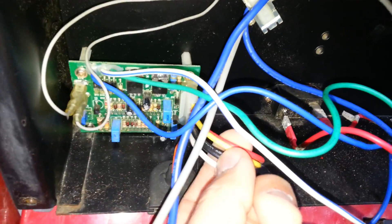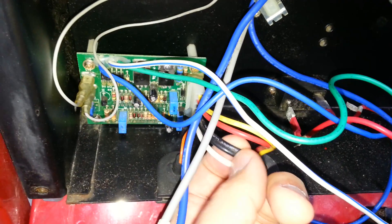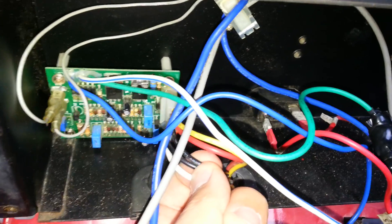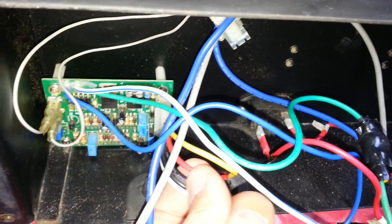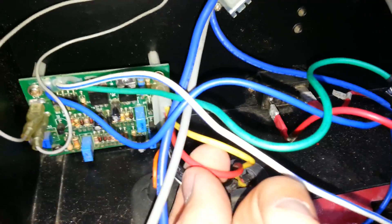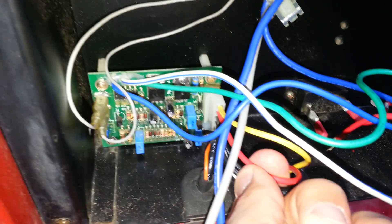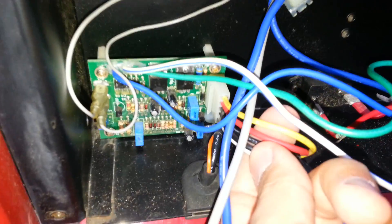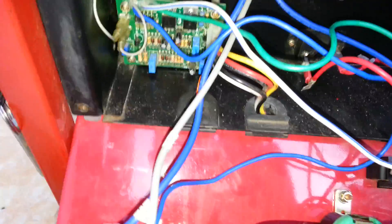The yellow wire is for the low oil sensor switch. The two black wires go to the idle solenoid itself. The red wire and white wires are for the other part of the wiring harness that operates the low oil pressure switch and other components, including part of the ignition — to ground out the ignition.